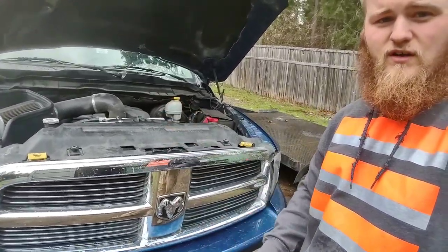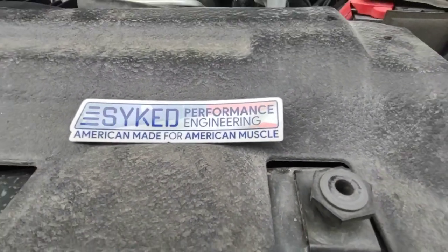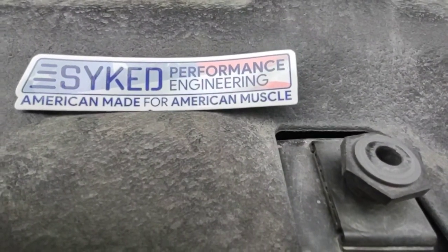I'm hoping the electric fan will fix the water pump issue. The clutch fan is obviously not on here anymore. The water pump is not a fun task — you have to take the whole front end out. The last time I did it, which is recent and why I switched to the electric fan, I kept the radiator and condenser and was able to get back there, but the job's not fun. A guy on the Western Washington Mopar page did a fantastic job — he was able to hook up to the computer, adjust the fan temperature, and also turned off the MDS.